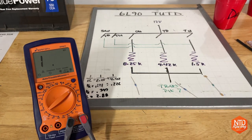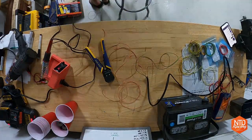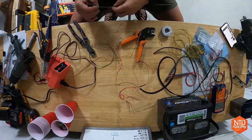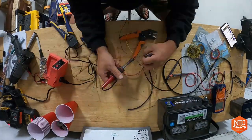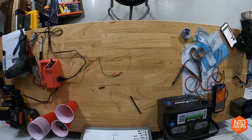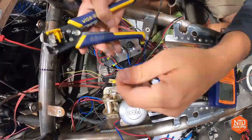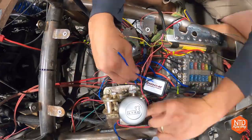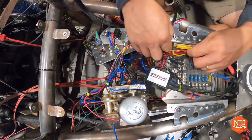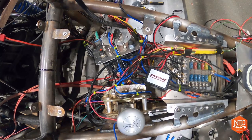I don't like to think of myself as a cheap guy, but I am a value guy. The wires I'm using here are really small gauge — maybe 20 or 22 gauge. They're wires I pulled out of the harness when I gave my LS engine harness a diet and pulled a whole bunch of wires out. They work just fine — they work forever. There's just not a lot of current going through these; remember it's just a signal that reads a different resistance going into pin seven. No need to go out and buy expensive wires.